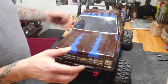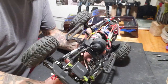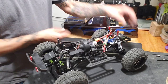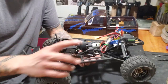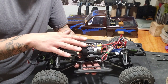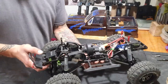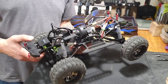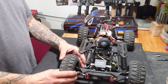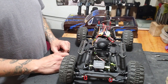That's what I've got going on — I'm gonna keep you guys updated. The next video will be once I get the body lift kit installed. I've also got a 60-tooth spur gear and a 15-tooth pinion gear, which should give El Chapo a little giddy-up and make her scoot nicely with this Titan 550-can. Stay tuned — she'll be lifted, sitting on 2.2 Mudslingers, and I'm going to get to work on mounting the body. See you on the next one!